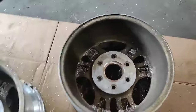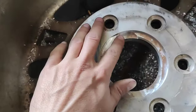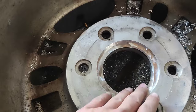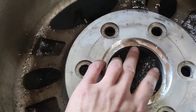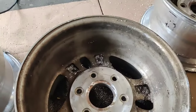So first pass was pretty good. I've gotten a little bit of depth in there. On this one my router bit kind of started to sink so I had to stop part way, go back and tighten it up and lift it up a little bit, but I didn't go too deep. I'm planning on going deeper than that anyway so I should still be good. These other two turned out beautifully and so it's time to go for another pass.